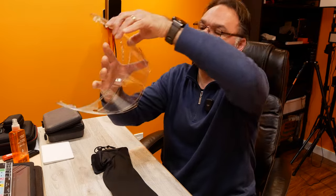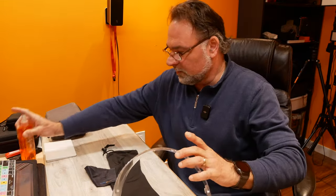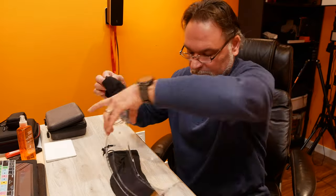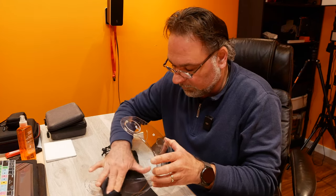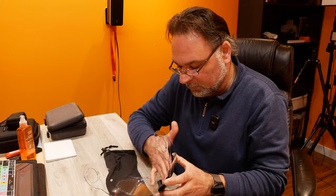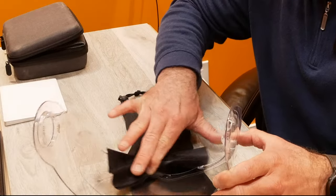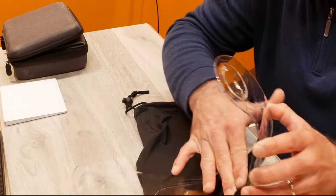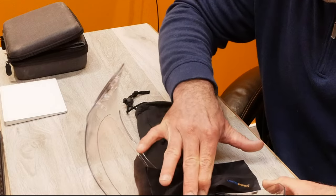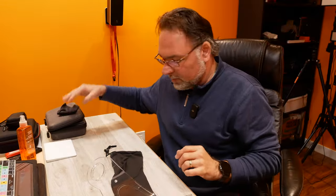Once the pin lock is lining up well, take the red protective layer off. After installation, clean the whole visor one more time on both sides before sticking it back on the helmet. Use gentle wipes — don't press too hard because extra pressure with any debris will scratch it fast. Make sure you're doing this at room temperature so the adhesive sticks properly, as cold conditions won't allow it to adhere well. Go one more time around the edges to make sure the seal is solid.